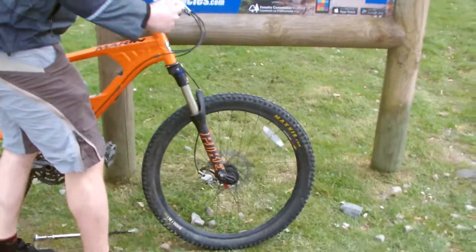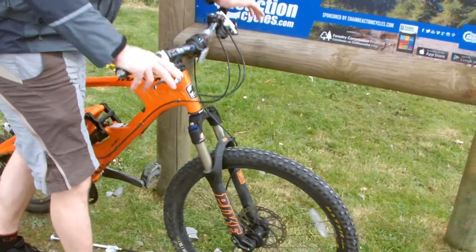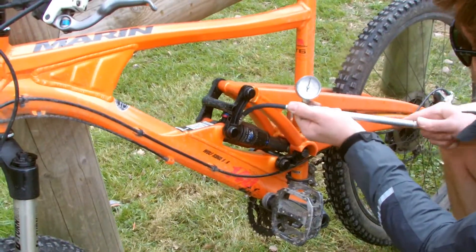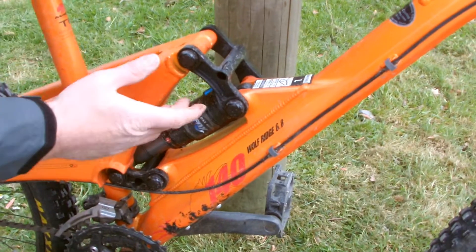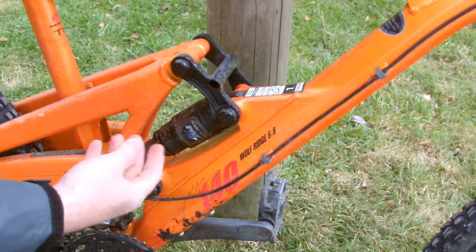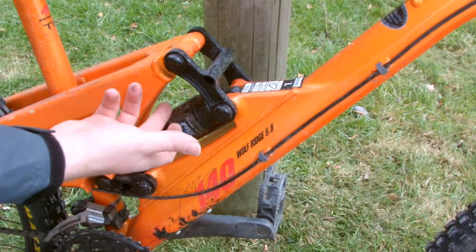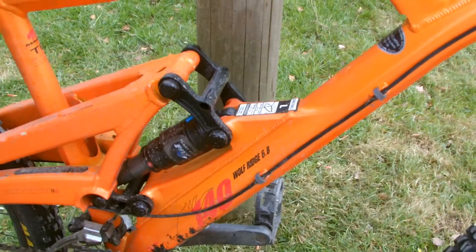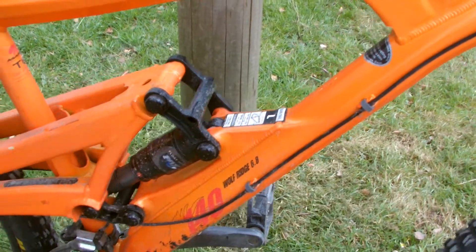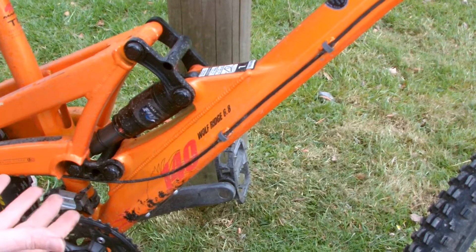So it's coming up faster... slower — then the rebound is less quick. The rear shock is a similar kind of idea: it has compressed air, but it also has this little system here which changes the damping in the system. It's called a pro pedal, because when I'm climbing I don't want to put all my energy into depressing this rather than pushing the bike uphill. If I flick it across, it damps it and makes it harder for the spring to depress. If I push it this way, it should be softer and we get a more comfortable ride over bumps.